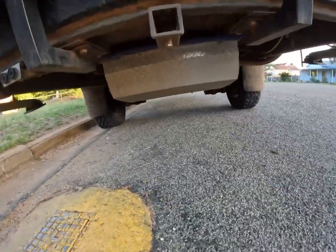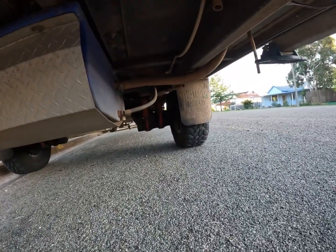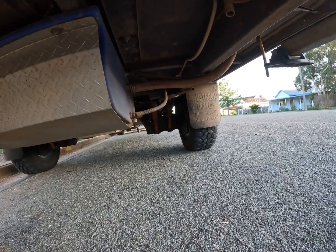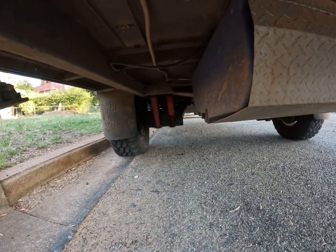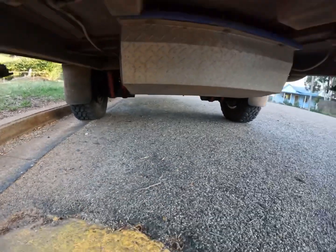So the reason we're going - you can see the shocks there. They're all leaking and they're not doing their job anymore. The size is the same and it needs a wheel alignment too. So it's going to get the wheel alignment, going to get the shocks, going to get all new bushes. It's going to get the works and jerks.